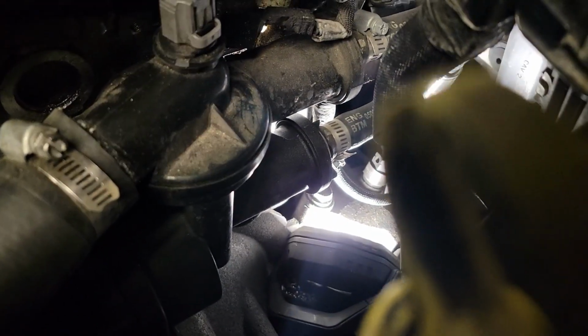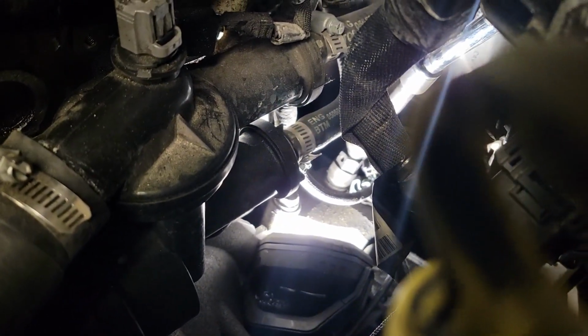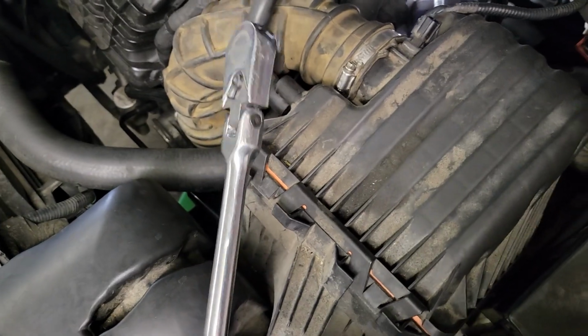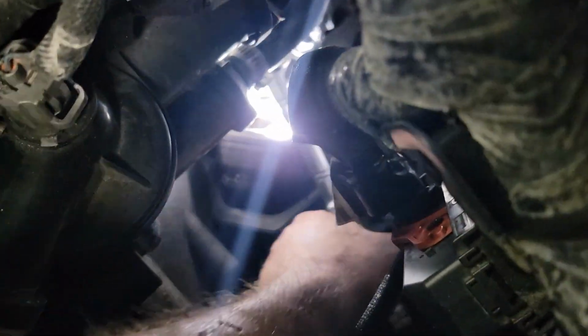It'd be a little to the left of it. There's one more bolt that's closer to the block. You'll see how easy it gets in there. And other than that, it should be coming out. On that last bolt closest to the block, this long ratchet, there wasn't enough room to maneuver it. But I have just a regular 1/2-inch ratchet on the 18 millimeter down there, and the whole ratchet can move in here underneath. The other handle was just a little bit too long and hit up against the shock tower.